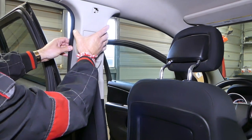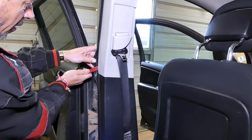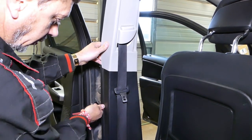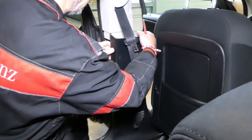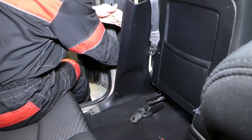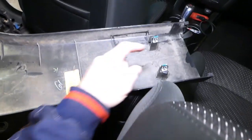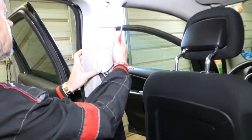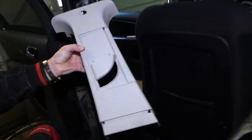It'll be interesting to see how we're going to install it later. Now we have a couple more clips that we need to remove. On most cars it's the top piece that comes out first, but on this one it's the bottom piece that comes out first. You have one, two, three, four clips. Now we can go ahead and pull that piece — the screw stays in there if you don't take it all the way off, so that's a good advantage because that way we can't drop it later.